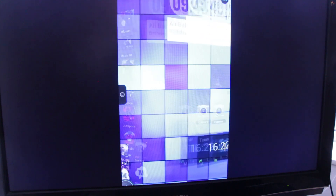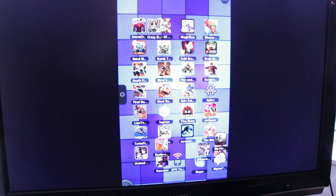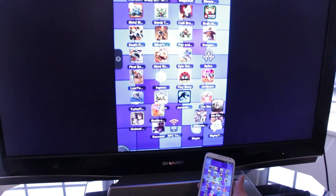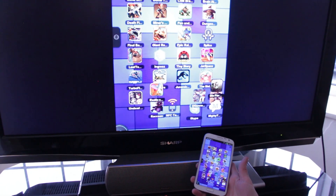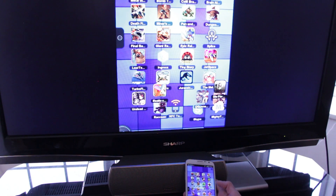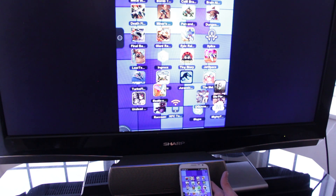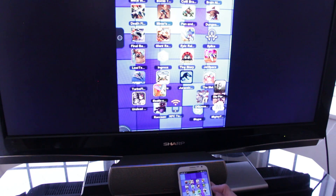What I would recommend is there's an application you can get which turns off your screen so that when you're plugged into a television you don't have to have your phone screen running as well. The screen on the Note 2 is also running in real time. What the application does is it doesn't turn the screen off but turns the backlight off - the backlight is the element that burns out the quickest. So anything you can do to avoid running effectively two screens simultaneously when you're only watching the big one is a great boost to the overall life expectancy of the phone.